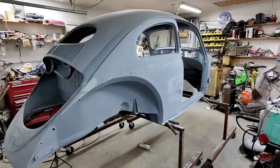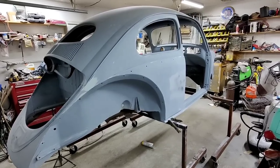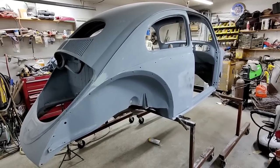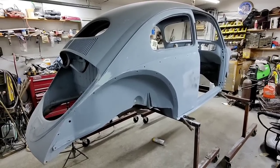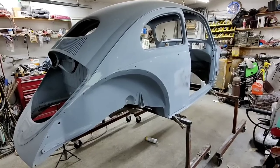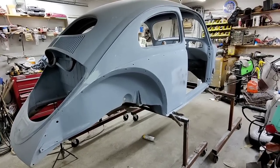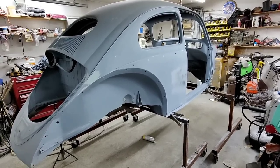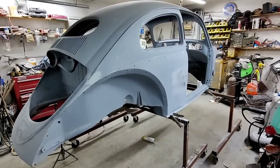And the reason that people got into this craziness is because one thing happens and then all of a sudden everybody starts to follow that. They go, oh, well, I've used filler and it got moisture in it and it retains moisture. I've taken off so much filler in my lifetime, and it's really rare that I see rust under the filler. I think the only times I ever see it is because some knucklehead ground it down, left it outside overnight, and then just put the filler over it, and that was it. So a lot of these things, I think, are farce.